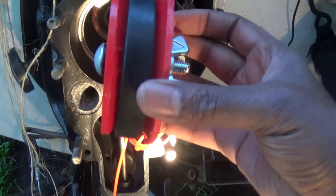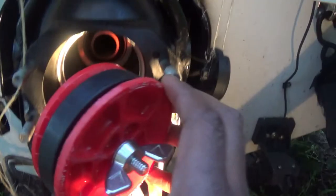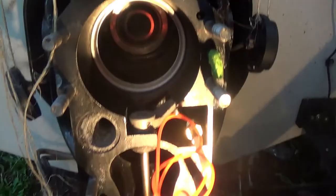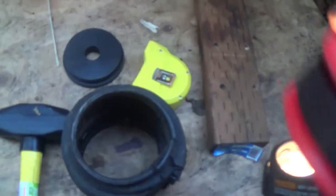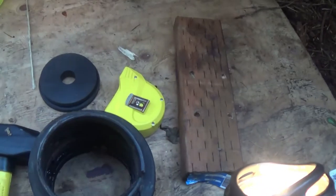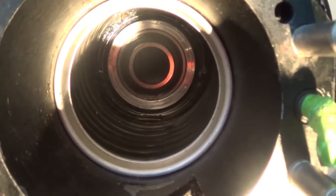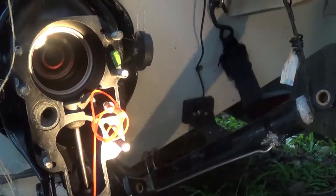So that's the trick right there: Home Depot, grind the front of it off so you'll be able to put it in the housing, then put it between the bellow and the housing. You're going to turn it and it's going to expand, and it's going to make that rubber compress. Once that rubber compresses you'll be able to get that ring in there, and that thing is super tight — it ain't going anywhere. That's my solution and it worked.